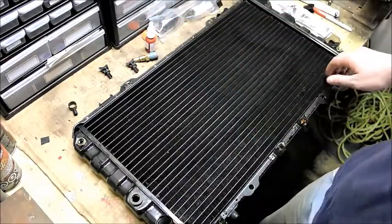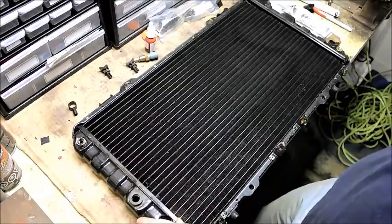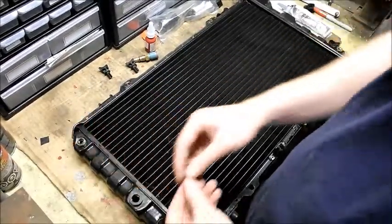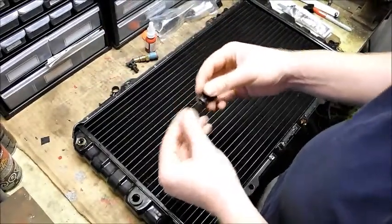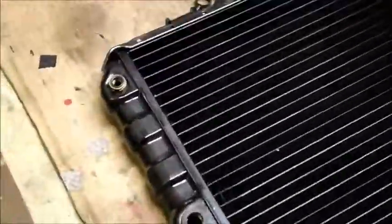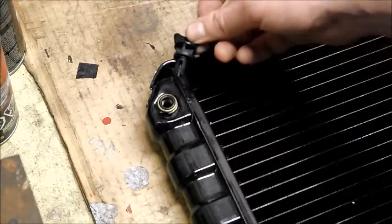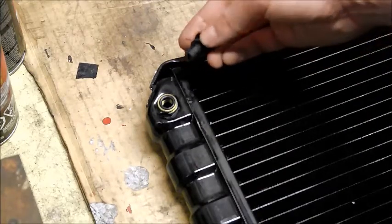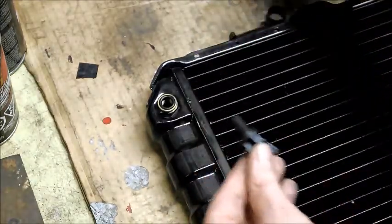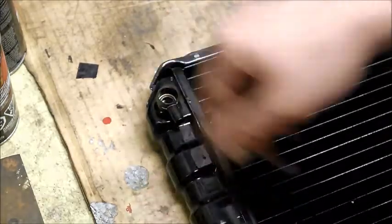The next thing is combating leaks at the drain and the air breather. The problem is the crappy floating design of these drain valves and the poorly made screws. Looking closely at the air breather — there's an O-ring so that when the screw is set, the O-ring is pushed flush against the surface for a nice seal. But when you unscrew it, the edge of this screw, which slides in the breather part, doesn't have an O-ring, so coolant gets all the way around and just starts leaking out.